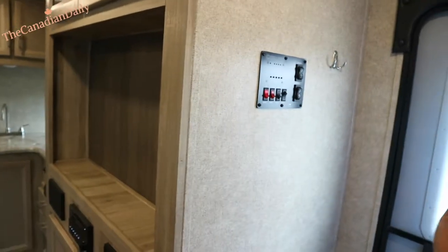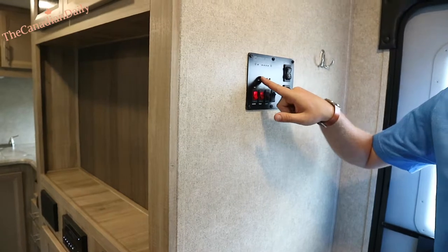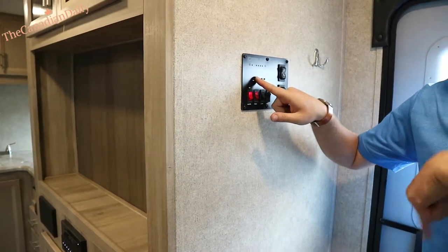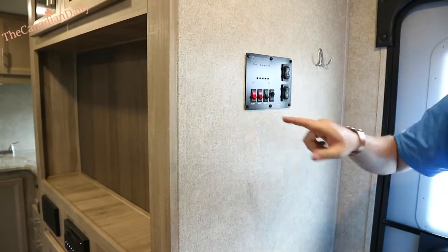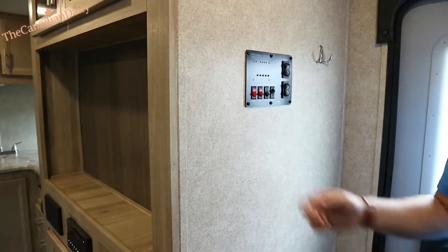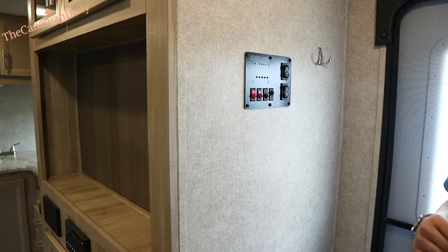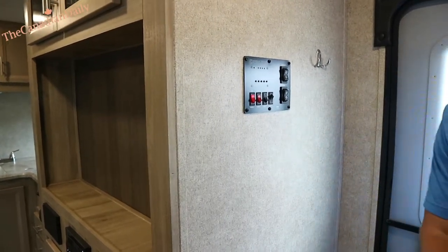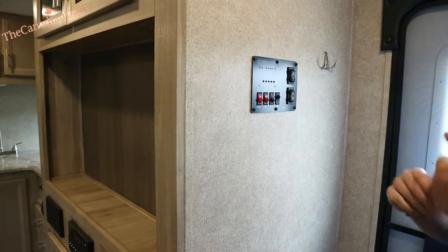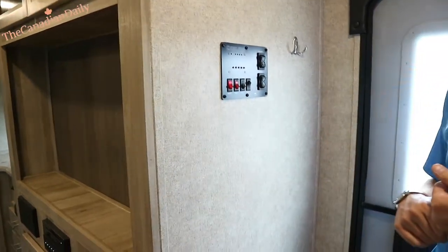Your DSI is just propane heat. I already have your propane on — I turned your tank on earlier. Make sure there's a water source — right now I know we have two-thirds of the fresh water holding tank filled up and the water pump is on, so it's safe to go ahead and turn that hot water heater on. This unit does have the electric option for hot water heat — there'll be a little black switch outside on the hot water panel.